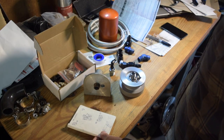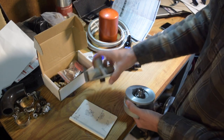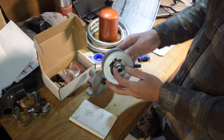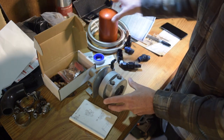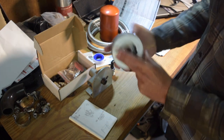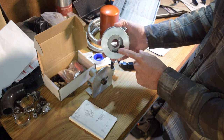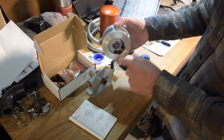Now that the majority of my plumbing lines are done for the cooler setup, we need to look at my remote adapter plate — this is the Moroso cast aluminum piece we've been using to mock this up. A new part to the equation is this sandwich adapter plate, which basically goes between the remote filter adapter and our filter. The way this works is it has a little coiled metal thermostat inside. As it heats up, it blocks an oil passage and reroutes hot oil into the cooler while still flowing through the filter — basically using a thermostat to control oil flow so your oil can actually heat up in the engine.